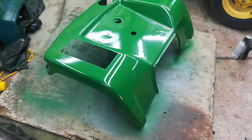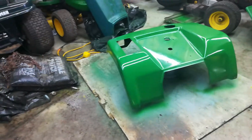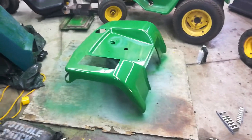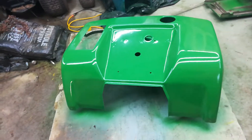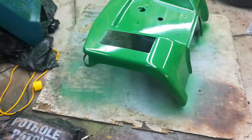Here is the fender pan. I already have it sanded down, I primered it, and I have three coats of paint on it at the moment. I'm gonna do a total of five coats — that's the golden ticket to make it look like a professional job with rattle can. I have to do two more coats today, and then I'm gonna clear coat it in three weeks once it all hardens and releases some chemicals. Pretty pleased with it so far.